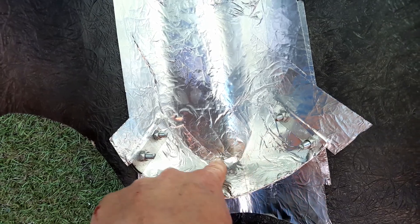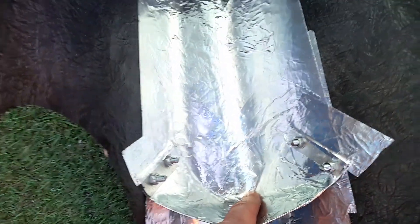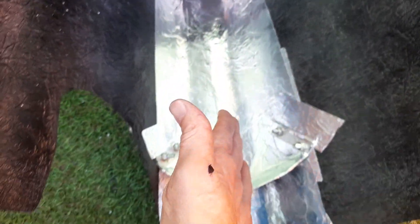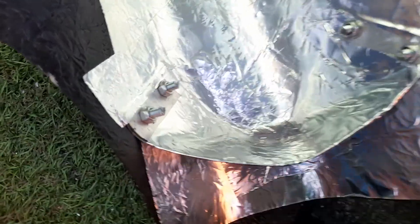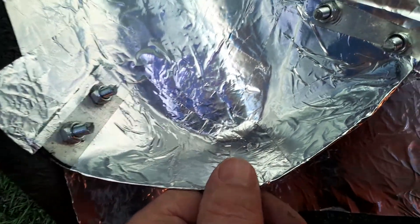As you can see, it's bolted on, and underneath is heat resistant foil tape, which is highly adhesive. I use this a lot because it is fantastic for dispersing heat — bear in mind this is under the engine — and the exhaust downpipe will be running along here at the back, so this tape will also stop the exhaust burning through the fiberglass fairing.